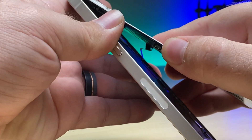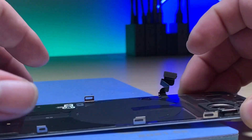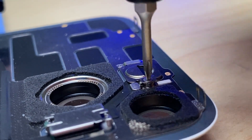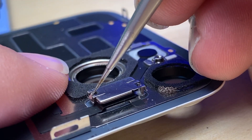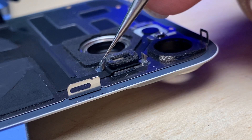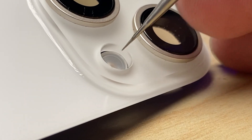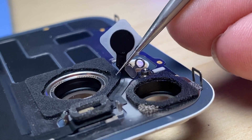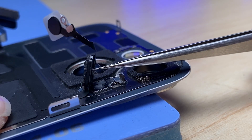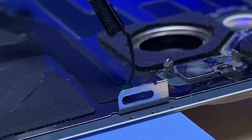Let me show you what it takes to transfer over the IC that's on the flex cable from one flex to another. I'm going to get out my heating pad, stick the back on it, and let that warm up for a minute. While it warms up, take this screw out along with the bracket — it just pops out from under the little hook and then pulls off. These brackets are really rigid; they don't bend or move. You have to pull it out from under that little hook on either side. The flash itself you can gently push out from the front, then the flex cable you can slowly peel back. Add a drop of isopropyl alcohol to help loosen up the grip that the microphone has on the frame, and then do the same thing for the rest — add some isopropyl alcohol and let it naturally want to peel up away, taking your time.